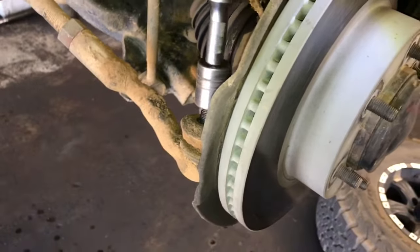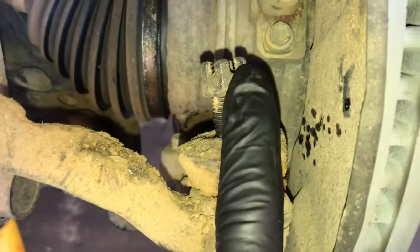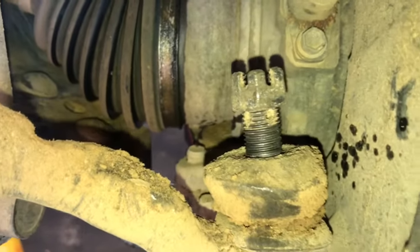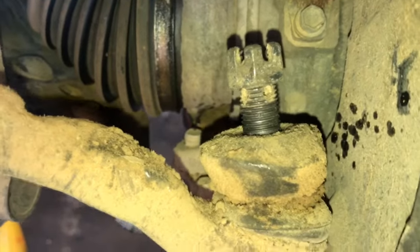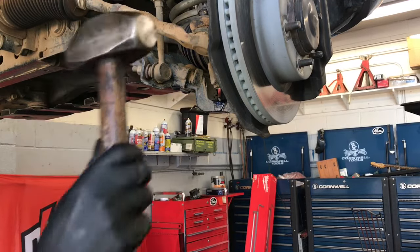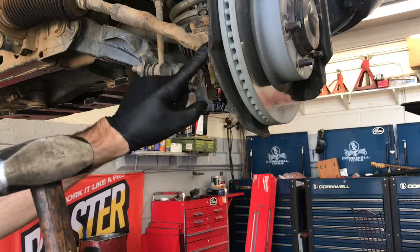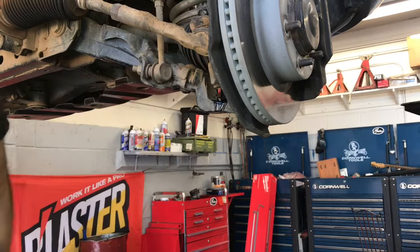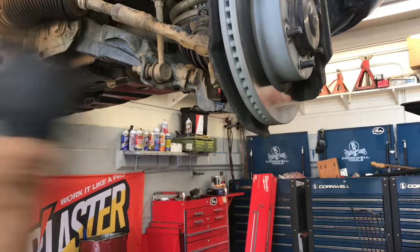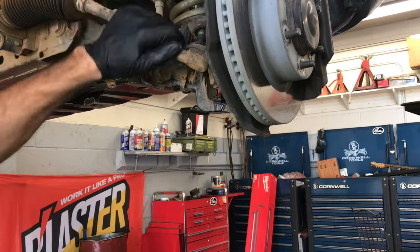The tool is about a half inch smaller than the old version and about 250 foot-pounds more torque. To remove the tie rod, I screwed the nut back on a few threads, then took a two to three pound sledgehammer and struck the end of the spindle to jar the tie rod free. That pops the ball joint portion of the tie rod out — doing it this way you won't damage the boot on the tie rod.